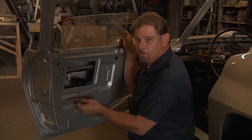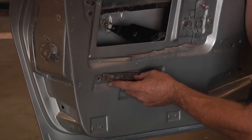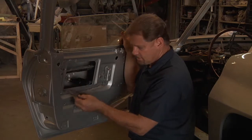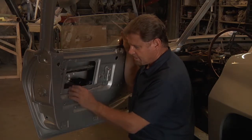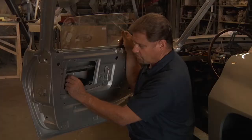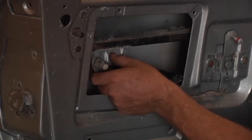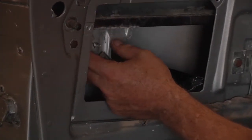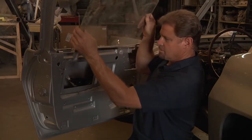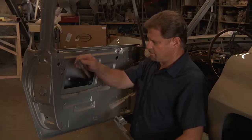When removing the large window, you'll be removing a small bracket located on the inside of the door — two Phillips screws hold it in. Slide it off the track rail, forward and up. It comes off real easy. Then you'll have two nuts holding the rail going across this window — two 7/16s nuts. Loosen them and take it off. Slide the window out of the track, then slide the window up carefully, tipping it in. Next, slide the channel off the roller and bring it out.